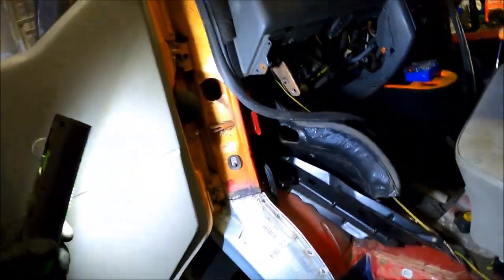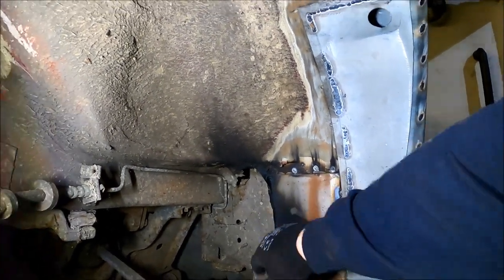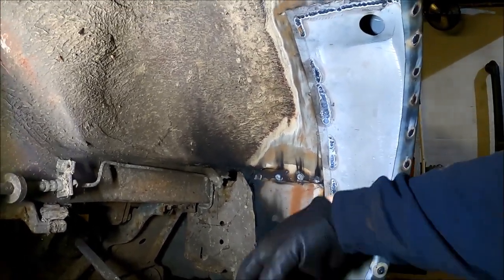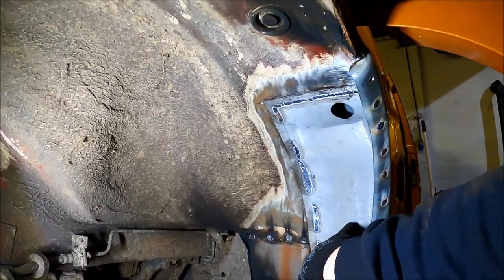Welcome back. More on the T4 — I have now put the front arch in. I've also fitted the closing panel here. There's still a lot of underseal there that still needs to be burnt off. I just used a bit of card, marked that up, and plug welded that back in. I've also fitted a new inner arch section in here.